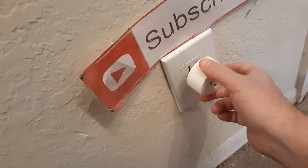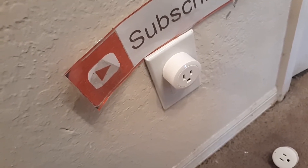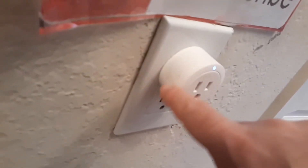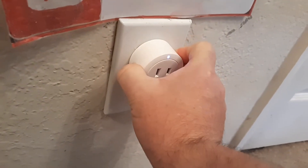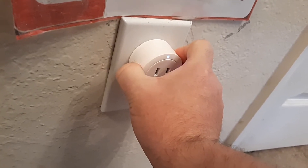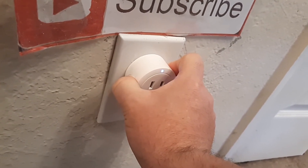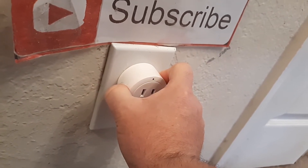Next, I want you to reset the plug. It doesn't matter what brand you have — this particular one is a Yuffie. You want to hold down the power button right here; some might be on the other side. Hold it down for the full 10 seconds. You can see it's starting to blink — some will blink blue, some will blink amber, orange, red, then blue, and some will just blink red. This is doing a factory reset, which is what you want.